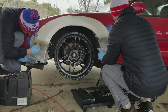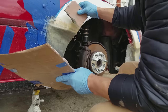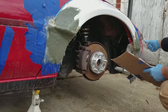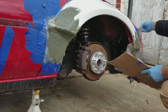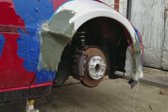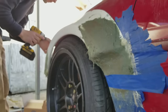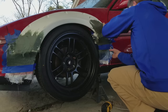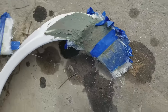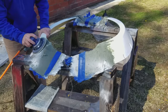After putting on the fiberglass, I really wanted these things to be strong — that joint where the new and old fiberglass meet is a weak section. So I covered everything with fiberglass filler. I really love this stuff; it's like Bondo but way harder and way better for structural pieces. There were some waves and lumps in the fiberglass so I used two layers of filler to fill all of that in. Once I was done filling, I let it cure overnight, then came back and started pulling the fenders off. They were stuck on pretty good, but wiggling and twisting got the part off. You have to be careful at this point because it's pretty easy to crack — it's not as strong as it will be in the end yet.